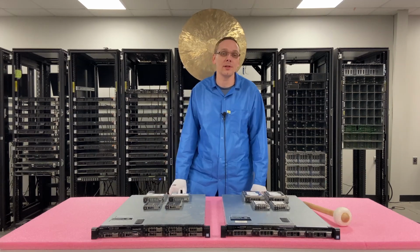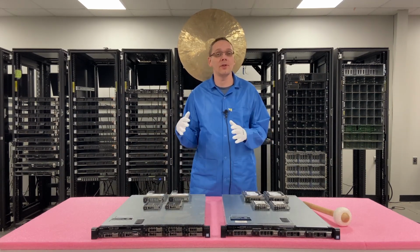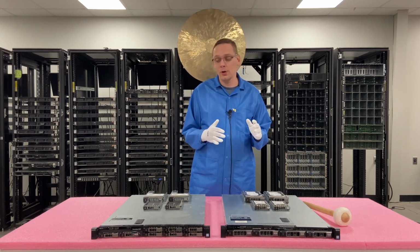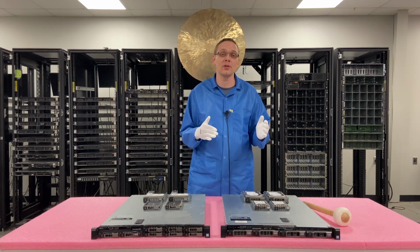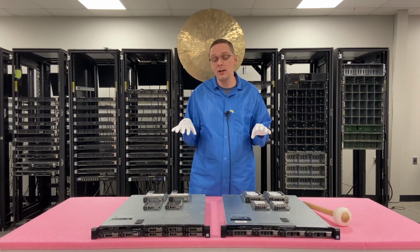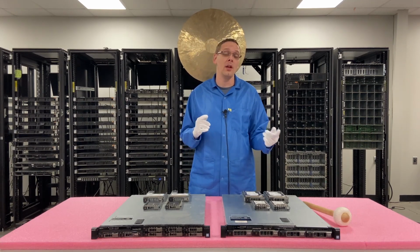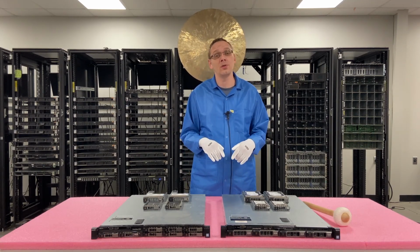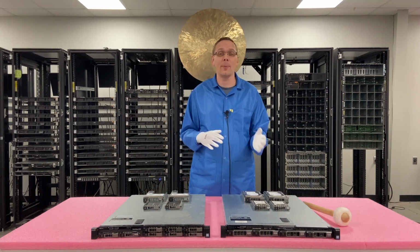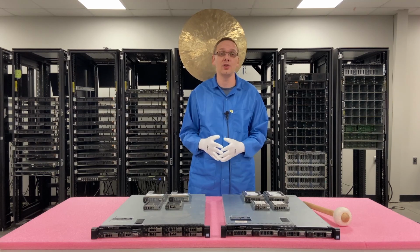This video, as we discussed, is going to be specifically focused on drives. So we're going to go over the different types, the different speeds for those types. We're going to compare them as a whole as far as the different sizes as well. Then at the end of the video, we're going to install them, run Dell Diag to show you how you can test them. And then we're going to use another tool called HD Sentinel to show you how to test for power on hours and health scores as a secondary test outside of just Dell Diagnostics.